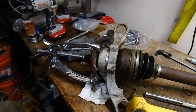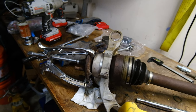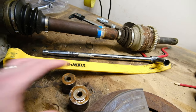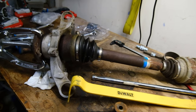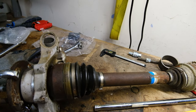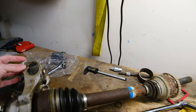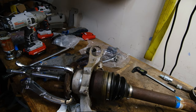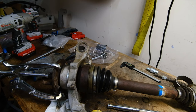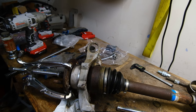Trying to get the axle out — it is thoroughly rusted into place. Here are the cross-axis joints. I pressed them out with no real trouble. The newer style that weren't recalled have machined surfaces, but these aren't machined, they're just as-cast. I may see if I can get these machined and save them as a spare pair. Anyway, the hunt's on — we'll see if we can find another set of uprights.